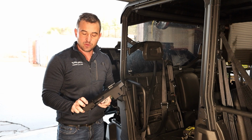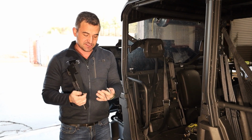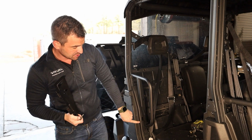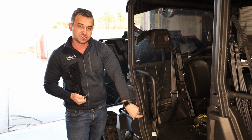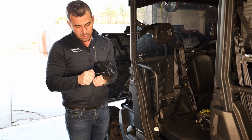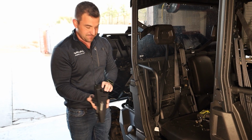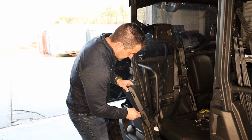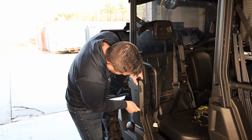Okay, so this is our bracket B1 or B2, depending on which side you're doing. This one is a little bit tricky. So this is a big spacer, and what we're trying to do is pick up this bolt hole down here. There's a threaded nut, that's a genuine part of the bike. So we've got a big 6x70mm bolt with a washer. We're going to put that spacer over like that, and we just have to try and not drop that spacer off as we go in.